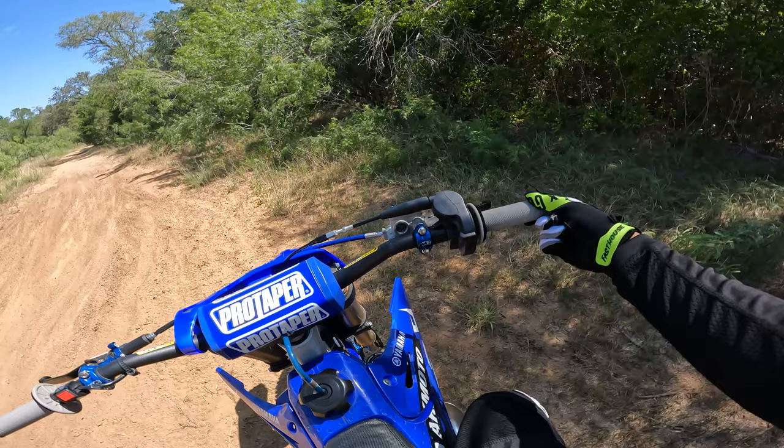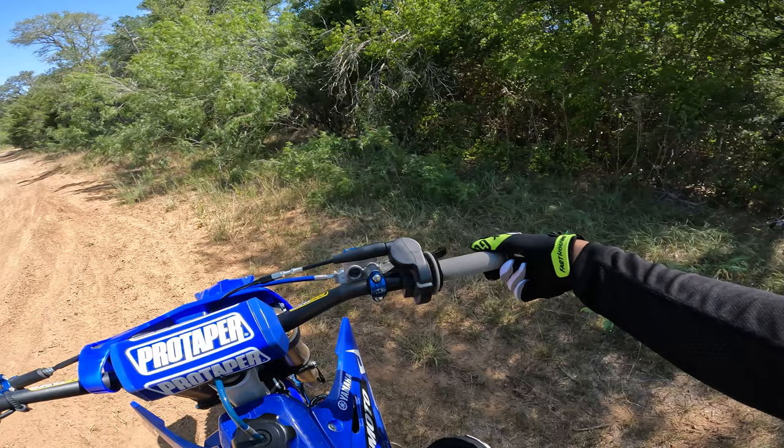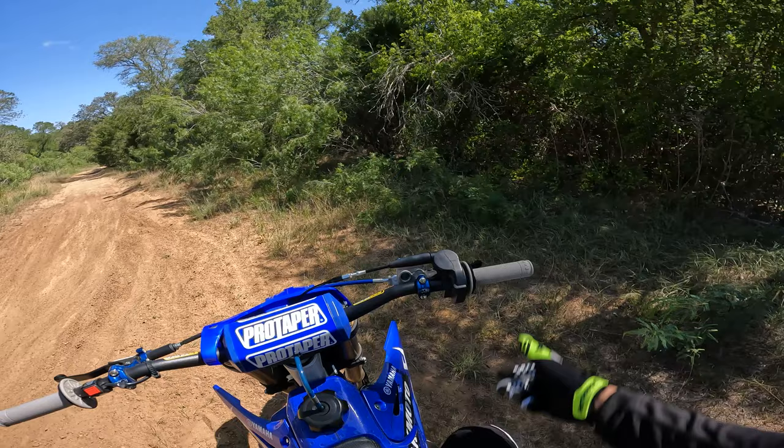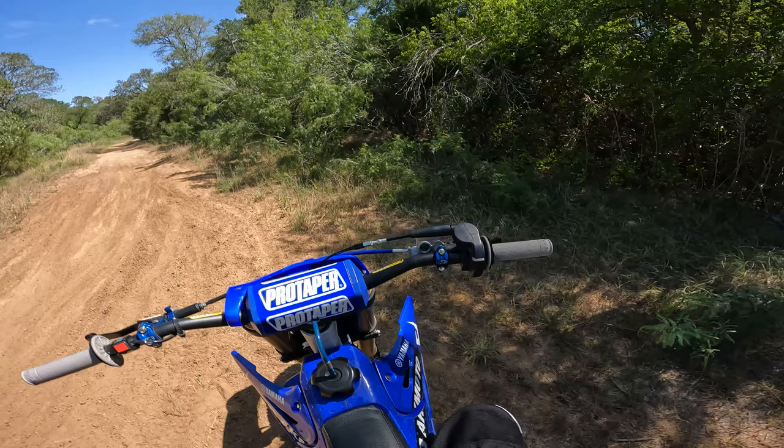I'm saying basically a ton, but you'll give it a little bit of gas, but the bike will shoot up in RPM. So like maybe this much gas, instead of going run, it'll go ring, ding, ding, ding, ding, ding, ding, and it'll take a long time to idle back down. That means you're running very, very lean. Versus when you're running rich, I'll give it gas, roar, and it will feel lazy. That's basically the best way I can explain it in terms of sound and throttle response.